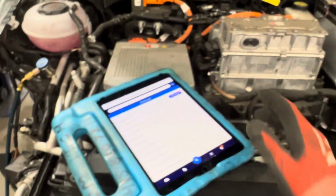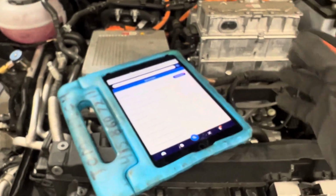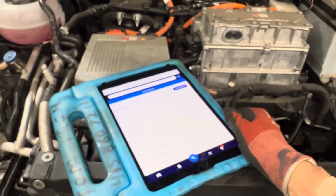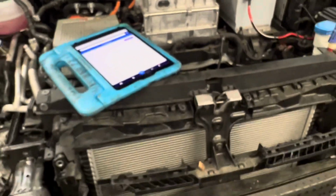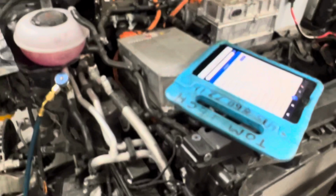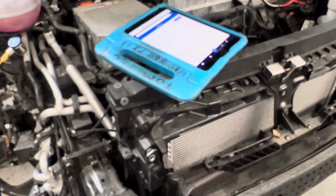I had two shops call me this month with blown engines because their guys did not properly purge the air out of ICE engines, you know, gasoline engines. One was on an AMG. And the guys didn't do it right. They thought they did it right. Old school guys who don't like to read, a shop owner who doesn't like to read, a service writer who doesn't like to look up information and read on coolant procedures, cost the shop $27,000 just because a coolant procedure wasn't performed right.